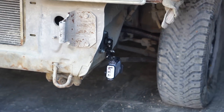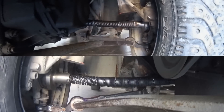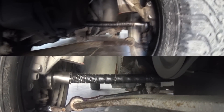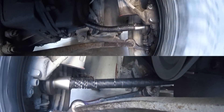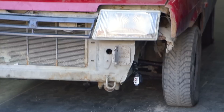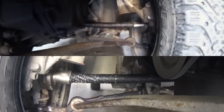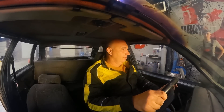Let's try reversing. Backing up. Oh, now it's alright? It drives okay — without any snapping and without popping out. That's weird. Now how can that be? Because it's turning the other way. Well, I'll be. It reverses alright. So here's the situation — it's turning over at the splines? So it bends, pops out, and then slips back in? Terrific.